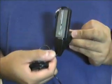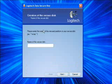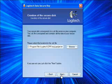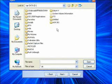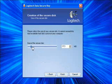Plugging in the data secure key allows you to bring up the DSK interface. From this interface, you can create or manage secure disks that utilize the DSK encryption ASICs. Setting up a new secure disk is a simple matter of clicking the Create button and giving the secure disk a unique name. You can select where you want the disk created and give the encrypted file a name. You then choose the size of your secure disk, which will determine the size of the EK file — the encrypted file. Creating the secure disk is a processor-intensive task, so the speed at which it creates the disk is affected by the speed of your computer.